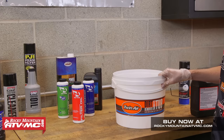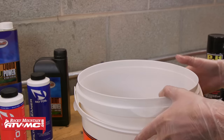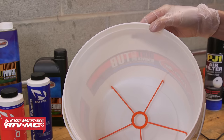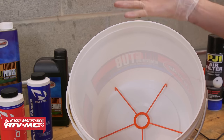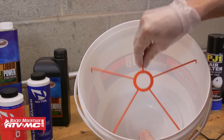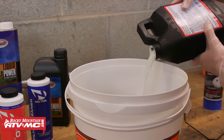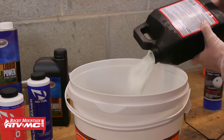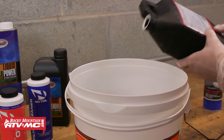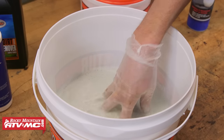I like this tub because it's tough and strong. I keep it in my garage and it's got a lid that seals really tight, which keeps the cleaner from evaporating. It also comes with a little screen tray. I keep this bucket half full of solvent and clean my filter several times in it — the dirt settles to the bottom and the screen keeps my filter from getting into the dirt. I'm going to fill this up with the cleaner, throw in the dirty filter, and let it soak for a couple minutes.